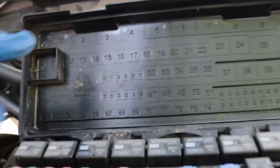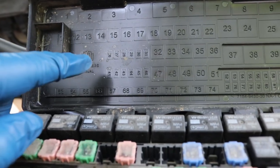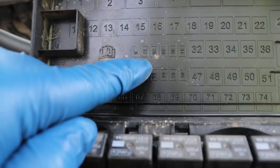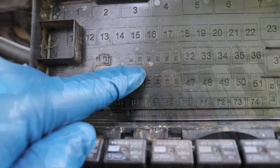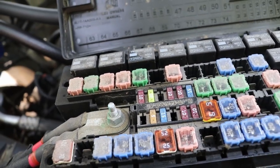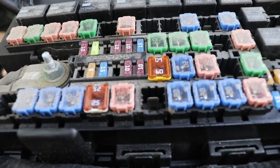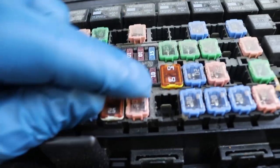Coming in here, we look up and you can actually see where every fuse is. We want fuse number 27, which is our fuel pump. Right there, the yellow one is our fuel pump fuse. We're going to relocate that right over here beside this pink one — it'll go right there instead. It'll be a J-case fuse instead of one of these little micro fuses.